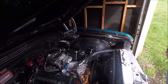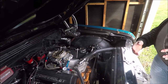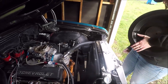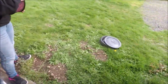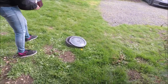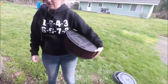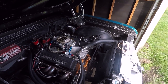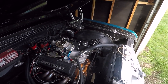Might need that someday. Probably. So probably don't need, unless we want to put a new gas tank. No, we don't. You might need that other stud though, because it's probably taller than this one. Is it the same size? I thought the new one was taller. I thought your old one was 3 inch and that was 4. Yep. So, you're going to want to set that somewhere. Take that stud out of the carburetor. Turn it.